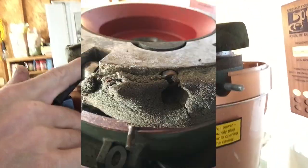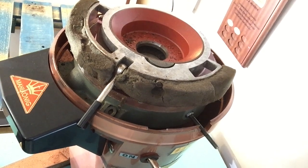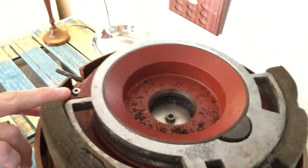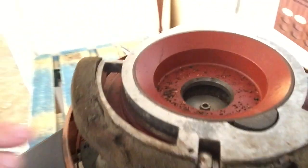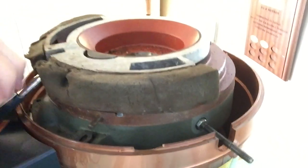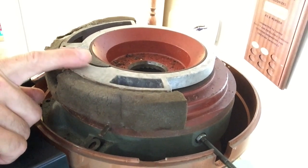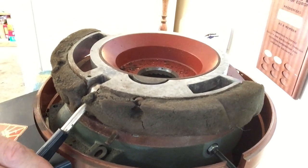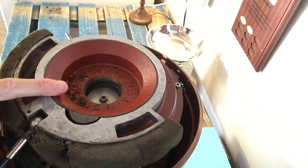You can see how this foam is just all torn apart — it's really in bad shape. I don't want that foam getting into my grinder or into my coffee. Going around the burrs, there is a hex head screw, but we're not going to mess with that. Once we loosen this screw, this is actually the one that holds the key. The key is where I make my coarse or fine adjustments. Then we're going to unscrew this red piece, which gives us the top of our burr.